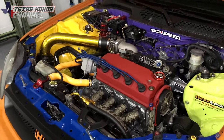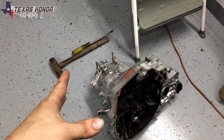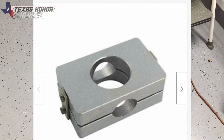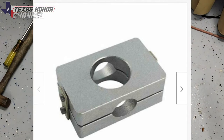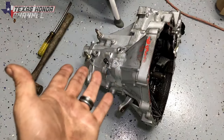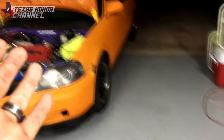It's running really good still and we still have the short gear transmission. I thought about while it's out, maybe we can save up and get the LSD locker — they support over 700 horsepower. My tuner Michael actually has one, just a cheap eBay unit, and it makes it a limited slip differential and it actually works. So we might try that, put in fresh bearings, and then put the short gear back in.